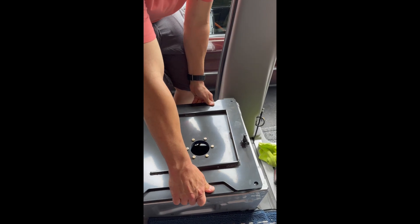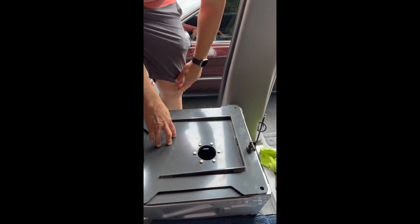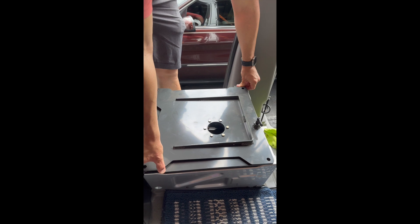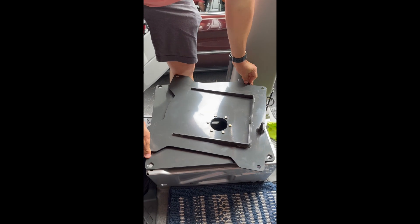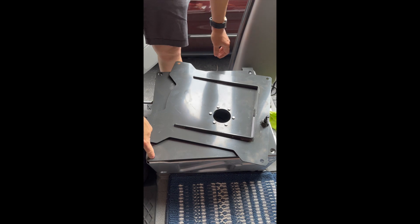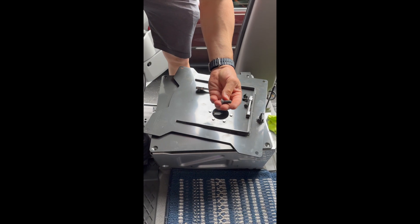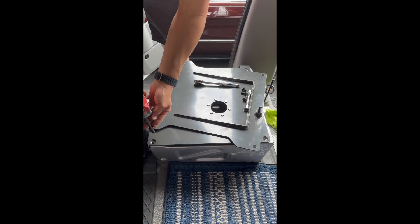Go ahead and lay the seat bracket down — it is heavy, so watch your fingers. After we get that laid down, I've got the bracket lock unlocked so this piece will spin. It's not easy to spin, but we rotate it to expose these holes, which is where we're going to line up our screws. Six millimeter allen wrench with the new screws — there are eight of these total, they're all the same so it doesn't matter. We'll get these threaded in.